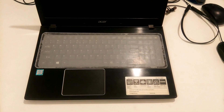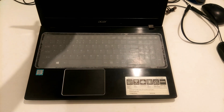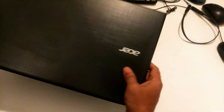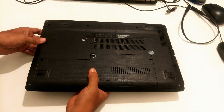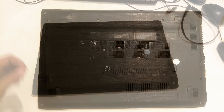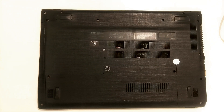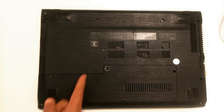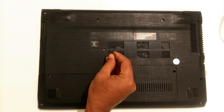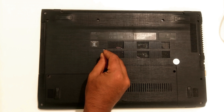At first, turn off your device and close the lid of your laptop, then disconnect the AC power cable from the electrical outlet. Flip your notebook bottom side up. Once done, you need to reset the battery using the battery pinhole reset button that is available on some laptop models. If your laptop has a battery reset pinhole, insert a paper clip into the hole and gently press for 10 seconds to reset the battery.